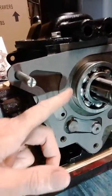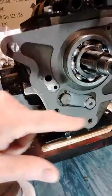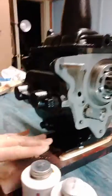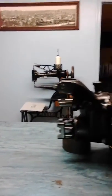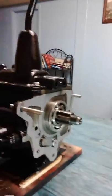This is another one of those great places for oil leaks to occur between the transmission and the transfer case. I'm getting ready to pull these together — I'm working by myself, which makes it a bit more difficult. I've taken the time to get the transmission leveled on some boards and I've got the transfer case set up on some blocks, got it pretty close to level so I can bring the two together, get the bolts in, and then replace the alignment pins with bolts.